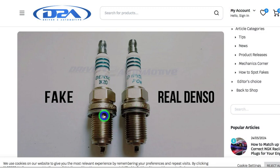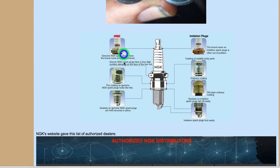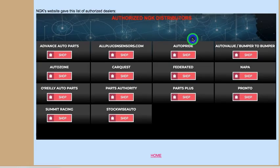The same thing goes for the Denso plugs — all the metal has a very gold color to it. For me it's mostly the color, but also the heat rating. I have a sneaking suspicion that all of them have a high number heat rating, because every one I've gotten runs colder than what it's supposed to for the number that's on it.